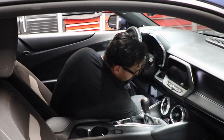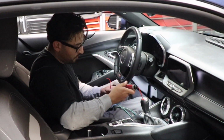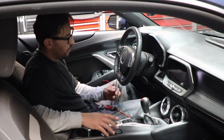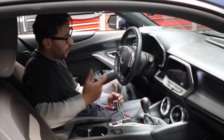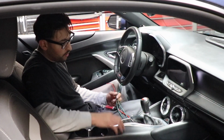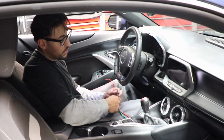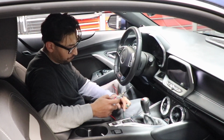So I have a test light here, and I'm going to check for switch power. You guys can see I have 2 wires already here. Basically, when I used to have my old AFR up here, I got power from the cigarette lighter, which is switch power. So I kind of left them here. Good thing, because now it's going to power our Zt3.